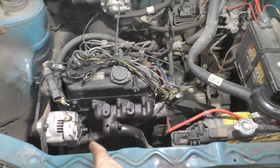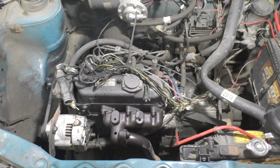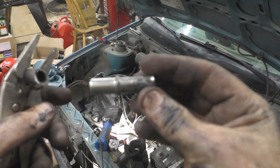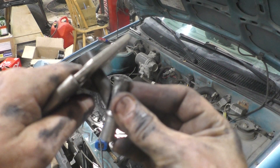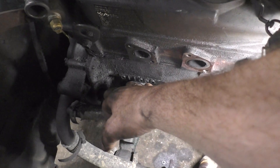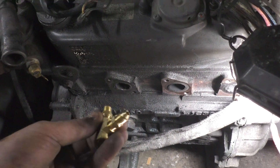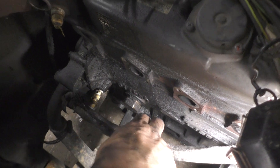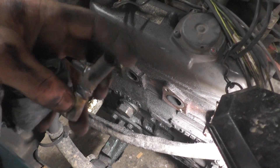I'm just gonna pull this manifold out, and I need to pull the dipstick tube out because that's where the oil is supposed to drain. I'm gonna add a little spigot off of that to take the oil return. Normally the dipstick's on the other side but the starter's in the way. We've got the dipstick tube out, all cleaned up, and cut the piece of pipe that's gonna go on it for the turbo drain - got to weld them together.